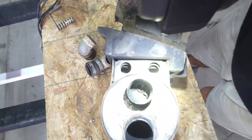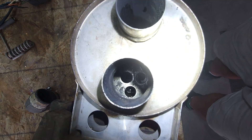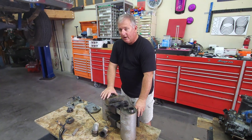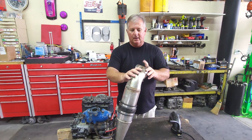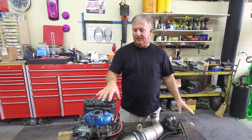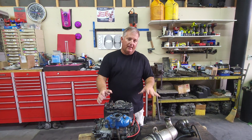Once we've fixed those problems, now we have to deal with the water box issue of generating too much back pressure. Down this hole here, you have a very strict plate that's blocked off and it creates a lot of back pressure. So what we do is we come over here to this other water box, and you can see there's two plates there. We've drilled three holes through two different sets of plates. That relieves the back pressure through the exhaust system out of the water box — that fixes our problem that was created by Kawasaki's repair of losing all their exhaust pressure out the back of this hole here. We've relieved the back pressure through the water box. We've repaired and replaced the back pressure here lost through this outlet. And we've put a T here to distribute the water away from the exhaust so we're not packing the exhaust with water. Like I said, we're not trying to modify — we're just trying to modernize. We're not trying to lose our stock reliability either, and that maintains that as well.